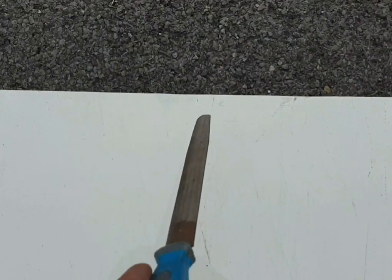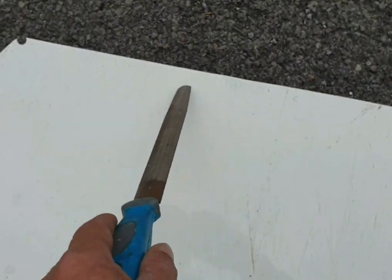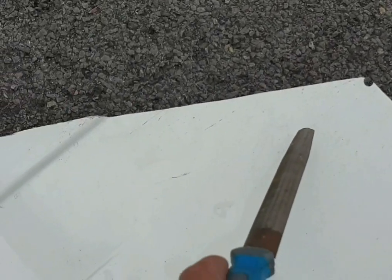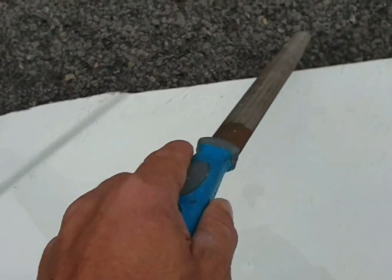Or you could have done it the other way, how I said. Get your centre point here, and measure the fiberglass that's this shape on the inside edge. Find out the measurement of that, and get your tape on that point and swing it round until it hits this point. And that should be the same as the 16 inches. But yes, to be fair, it's pretty simple.